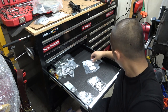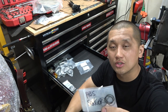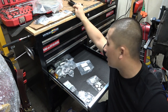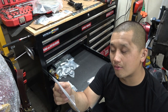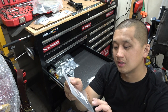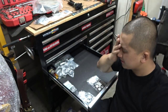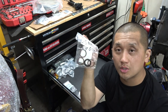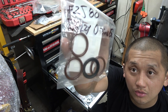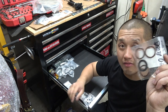I have the old-school brass-style spindle bushing as well — a couple bought off eBay. These are ABS sensor washers for the 80 series — the washers that go with the ABS sensor into your knuckle and rear axle. I don't ever need these anymore because I did an ABS delete, so I'll give these away. This is the oil pump gasket for the 80 series — the oil pump is known to leak — part number 1518866020. Always good to have a bunch of these. These are the distributor O-rings for the FZJ80 — common to leak — part number 9009914118. Always have a few of these.